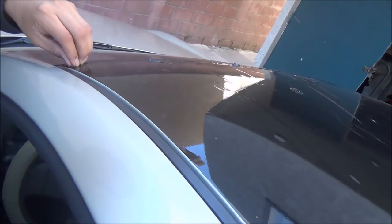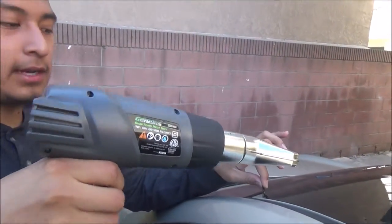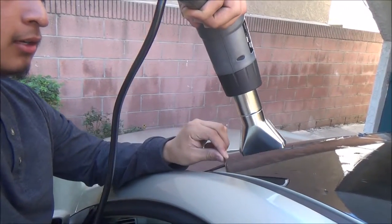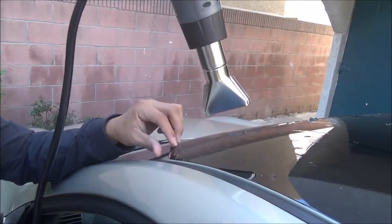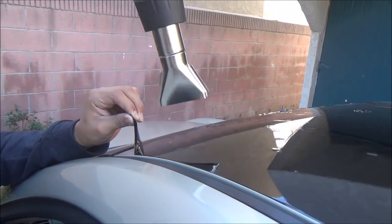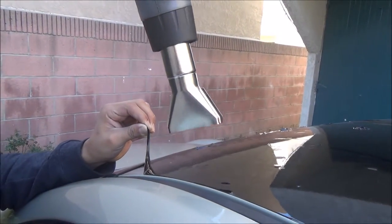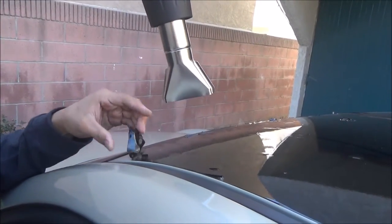Always make sure before you start, grab an end piece and slowly work your way along, cleaning it off as you go. The heat gun loosens up the adhesive so it's easier to pull the vinyl off. You could also leave the car in the sun for a while — that'll make the adhesive and vinyl a bit easier to remove.